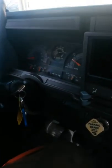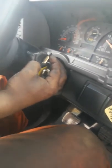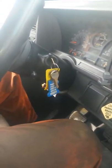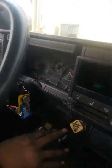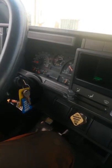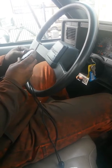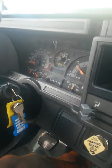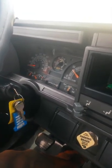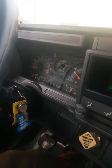This is where people make mistakes. We're gonna shut the engine off — parking brake is engaged so we don't have to worry about rolling. We're gonna push in the clutch, put it in gear, then push in the parking brake, wait for the needles to settle, get your stopwatch ready, stand on the brake, wait for them to stabilize, then start your clock. We're gonna wait one minute and see if they lose any air pressure — allowed to lose no more than three psi in one minute.